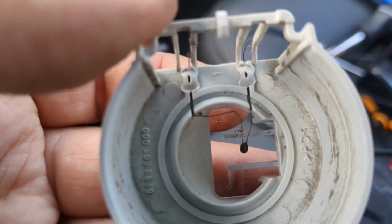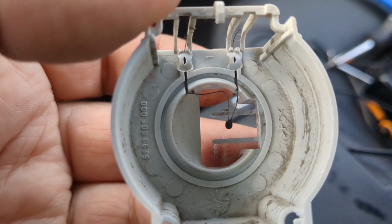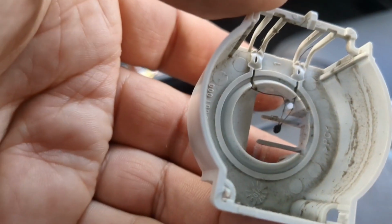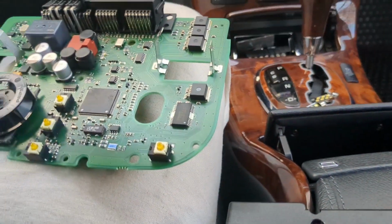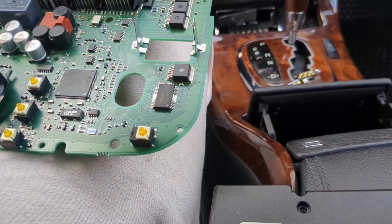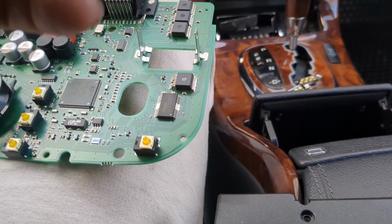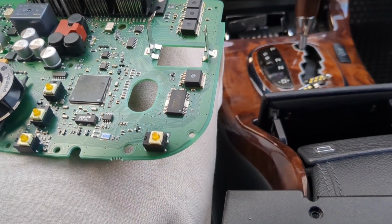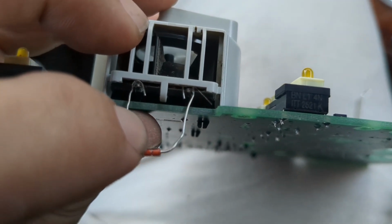And this is the culprit right here. The resistor's still in its place, but these leads that they give to it are some of the tiniest I've ever seen on any resistor. Why did they do that? Let's see, boys and girls. Can anybody guess? Can anybody say planned obsolescence? You gotta wonder. Was this the result of Chrysler and Mercedes between the years 2000 and 2006?